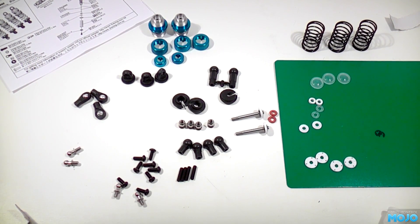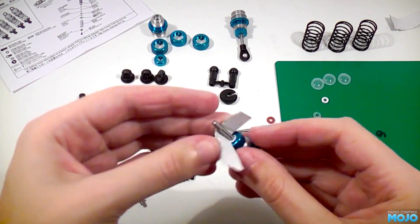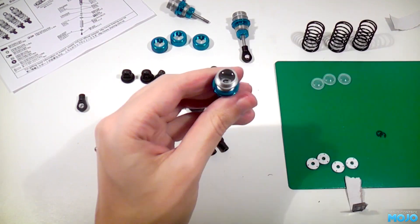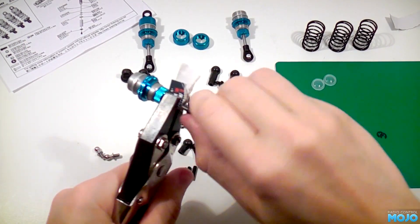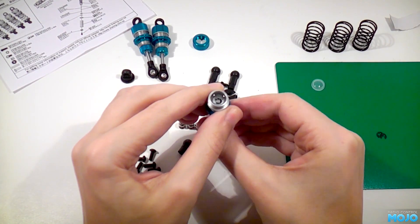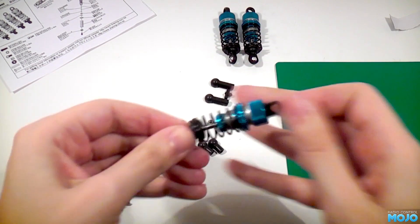The build of the dampers is pretty standard. A piston goes on the shaft with clips on both sides. The shaft then gets put into the body, with a spot of oil on the thread to help protect the o-rings, then an o-ring, followed by a spacer, another o-ring, and the end washer goes on — all held in place by the bottom cap. It's a tight fit, but it does all go in. Next, the ball end goes on. Remember to use some cards so you don't score the shaft. Now the damper gets filled with oil; slowly move the shaft up and down a few times to release any trapped air. The top seal and top cap go on, then it's just a spring and retainer. Repeat three more times and you'll have a set of dampers ready to fit.